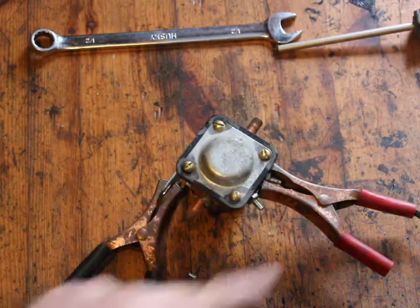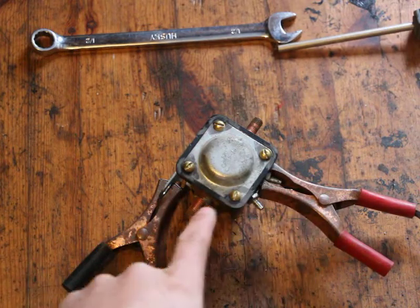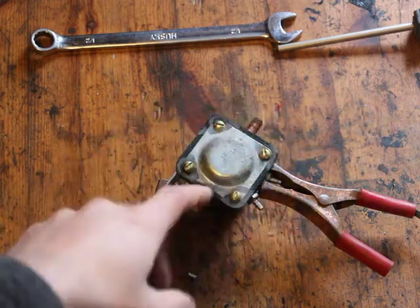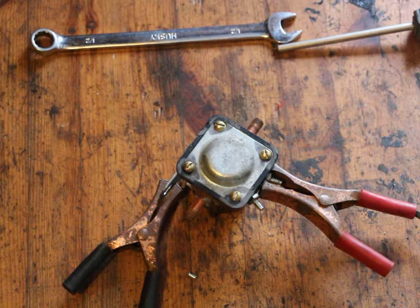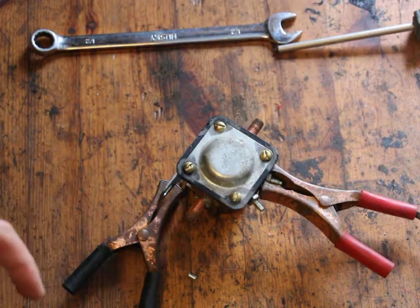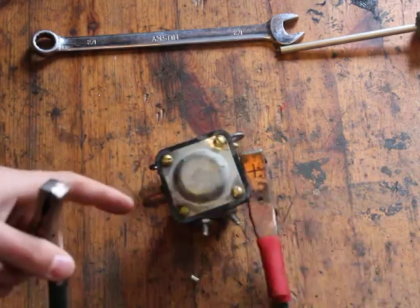The other lead goes to the S terminal, and once I turn the electricity on you should hear a click. That means that big round piece has touched these two terminals. Sure enough, there they are. I should get a light bulb just to show you guys, but anyway.